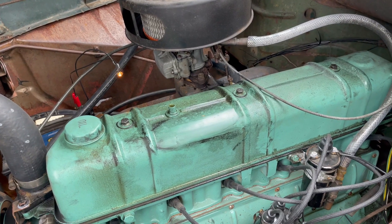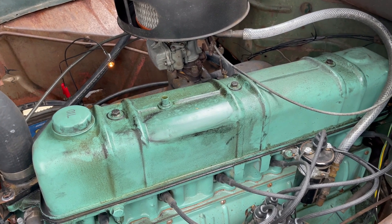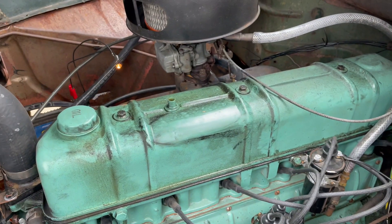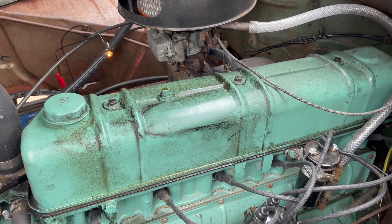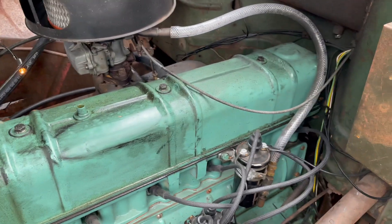You can see the test light burning over there — it's kind of dim. Actually, when I disconnected the alternator today it went totally out and then it came back in. So I'm going to try to find this.